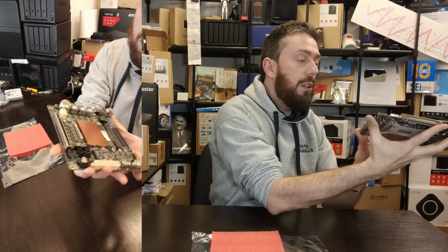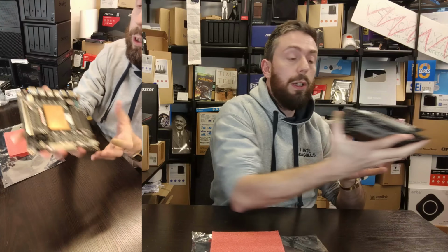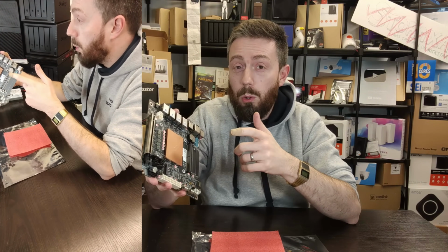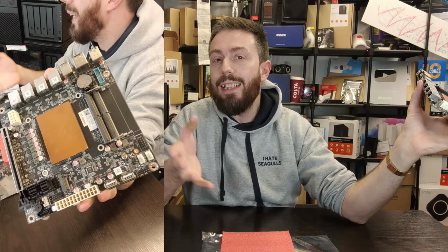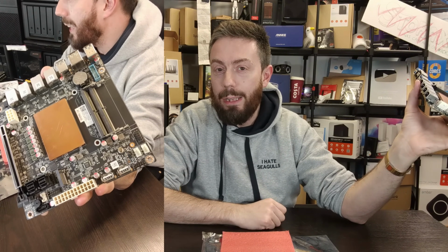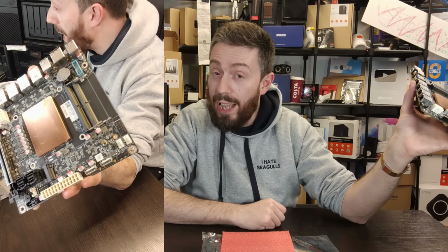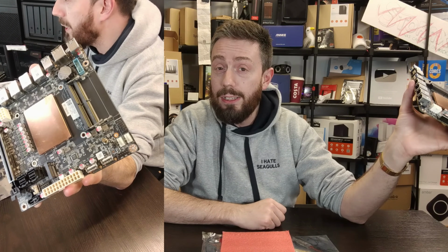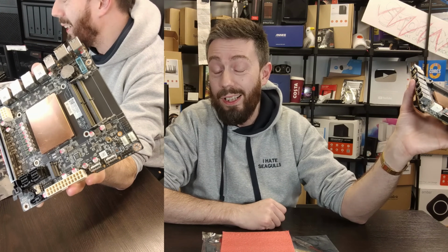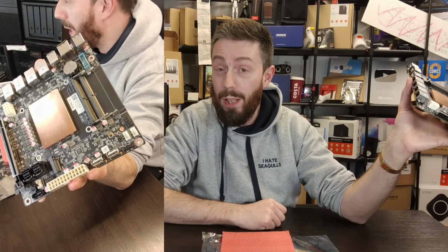But I will say, in terms of hardware architecture, this is actually pretty darn good for what you're getting there. So if we start off talking about that CPU, and I'm going to keep that there on screen for you, first up, let's dig into the specifications. The CPU is an 8-core 16-thread processor with a baseline clock speed of 3.8 gigahertz that can be burst when needed up to 5.1 gigahertz with a TDP of between 35 and 54 watts.